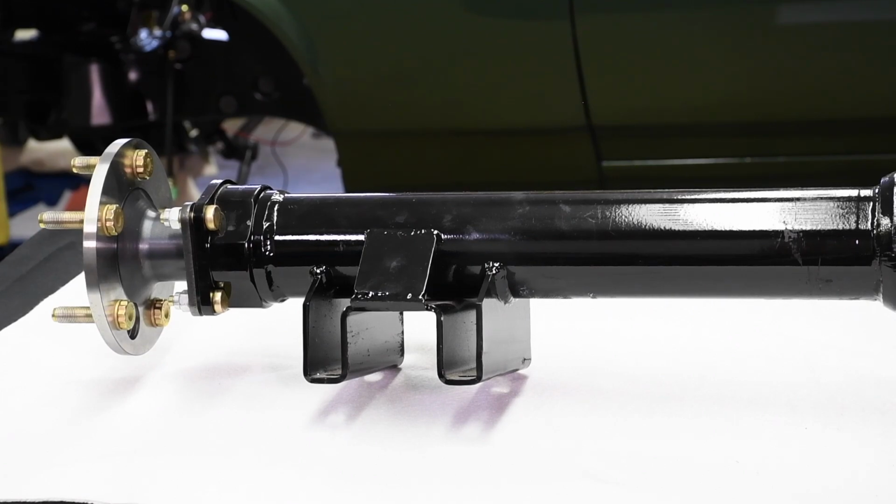This is fine for cars that see a limited amount of street use. The other housing end Mark Williams manufactures is designed with a heavy-duty Timken unit bearing with an outside seal. It's like this one. Unit bearings are self-contained assemblies and are engineered to carry heavy radial loads. They also manage thrust loads in either direction. Mark Williams builds this unit bearing setup for heavy-duty pro street and circle track applications, but they found it to be perfectly suited for street-driven cars too. We'll take a closer look at the bearing and seal later.